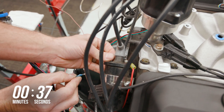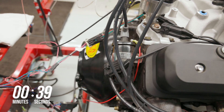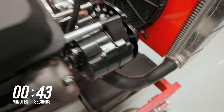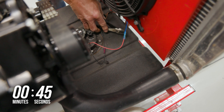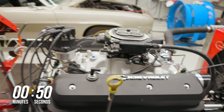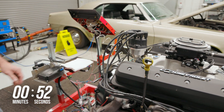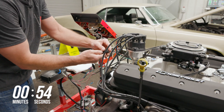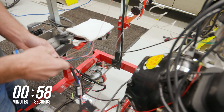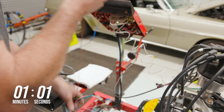There's no need to disconnect the coolant temp sensor, 3.5-inch dash, or the O2 sensor, since they plug into separate leads coming from the throttle body and not our main harness. We will also need to cut the blue wire that's supplying power to the fuel pump from the old Sniper harness. Disconnect the distributor at the connector and remove the tach wire from the dash if you have one. Then the old harness should be free.